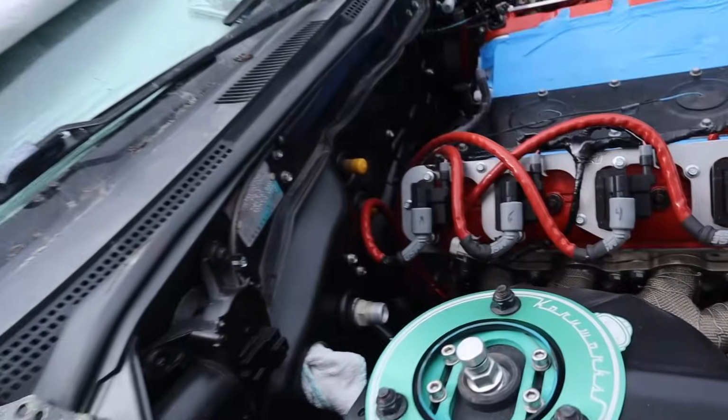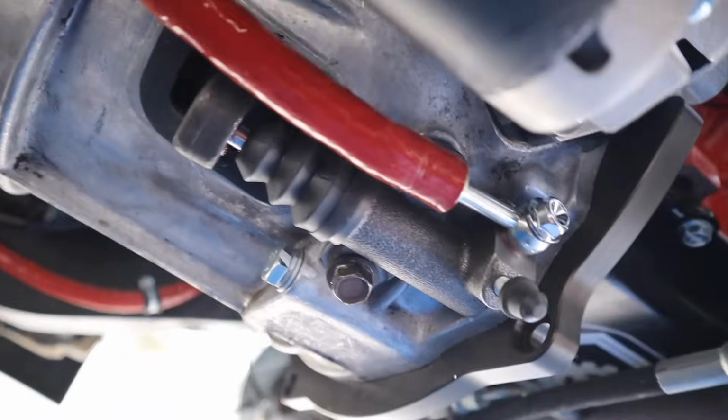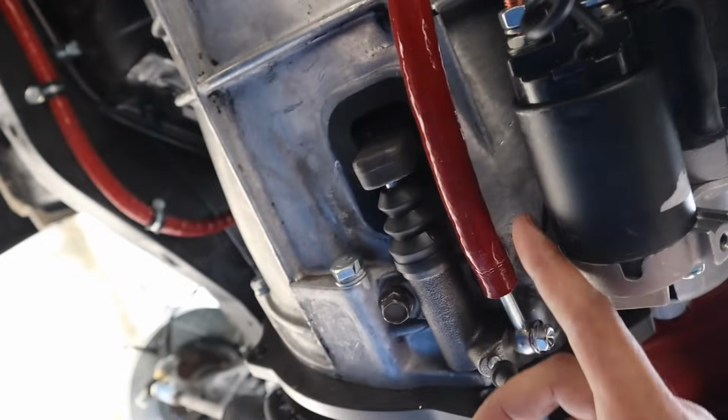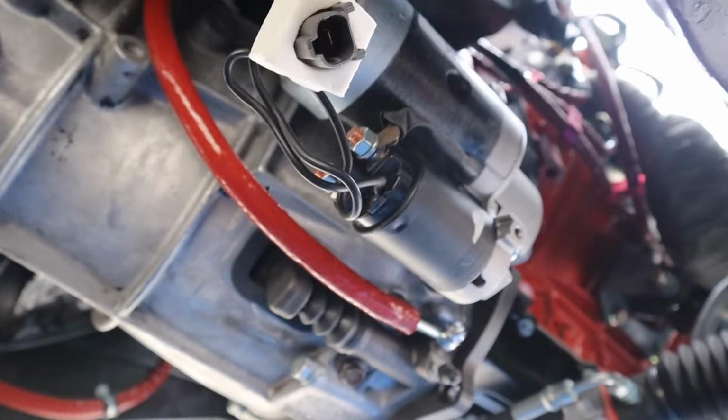That's pretty much it. So the last part that remains is just measuring the heat sleeve to add on to the clutch line. Alright, so for where the clutch line is going to be, we don't really need to do any heat sleeving because the material I use is like this hose, the brake hose. But down here, where it comes down to the trans and bolts up right there, we're gonna have this Mondingo downpipe coming through here, and I'm gonna get a starter heat wrap too for it to put around it, because I would not want it melting or whatever. So that's where we're putting the heat wrap. But yeah, it looks very good.